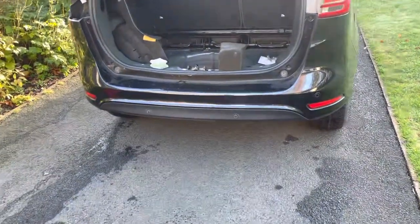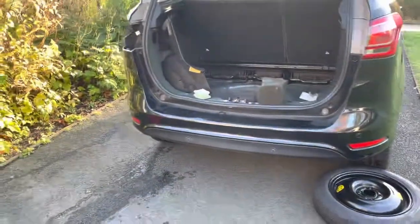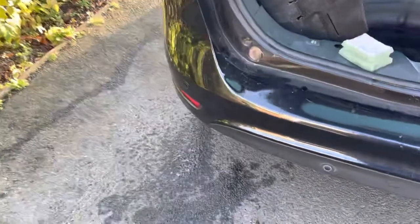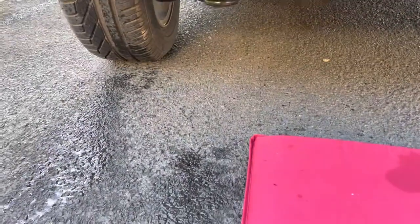I've moved the vehicle up to a drier position for safety — parked on the slope with the tire behind it, parking brake on, and gear in first so the car won't roll back. You can see water still trickling out from the lower chamber. Getting under the vehicle, that hole there is the one that leads to the boot — you can see the mounting brackets for the inside, and through there you can just make out the black tape or black mastic that leads to the outside world.